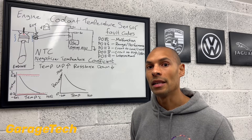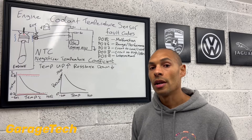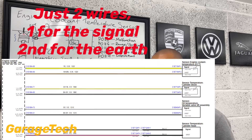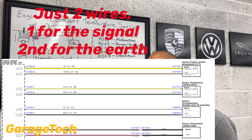After that, you tend to use a PTC sensor. So you'll typically find a PTC type of sensor on things like your exhaust, your turbos and things like that where the temperatures are a lot higher. Now, thinking about the way this circuit works, we're talking about the engine coolant temperature sensor.